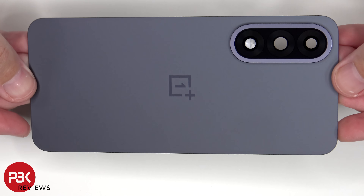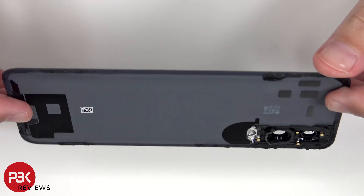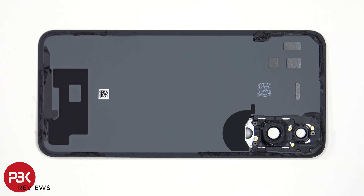Here's a better look at the glass back plate. The glass camera lens cover can be replaced by applying heat and prying it off, so you don't have to take apart the phone to replace that. However, if you're planning on replacing the camera bezel, there are three Phillips screws on the back which need to be removed.